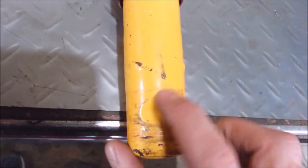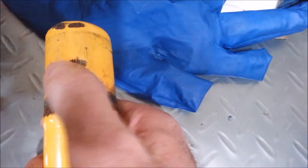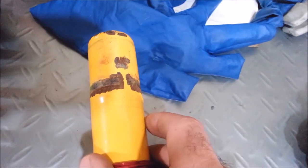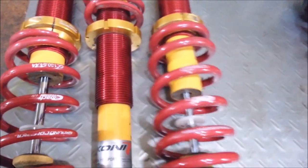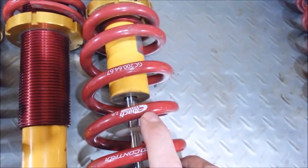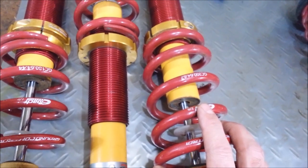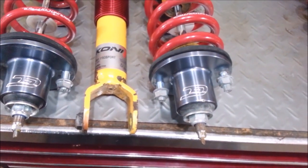One thing I noticed: there's a groove here where the pinch bolt goes, and the guy who assembled these just crammed the bolts in. On both of them they're all screwed up a little bit — this one moved on him because he didn't do it right. But it'll be fine; it's not going to screw up the valving at all. I also looked at the spring pressure — there are part numbers on these. They're the standard go-to springs: 380 front and 280 rear. That's about double the stock spring pressure of an SI of the same year. These actually came out of an Integra, so 96–2000 Civic — which is what I'm putting them in.